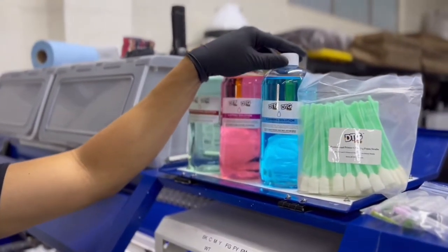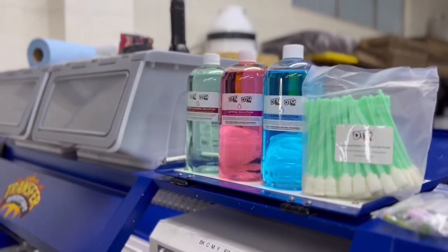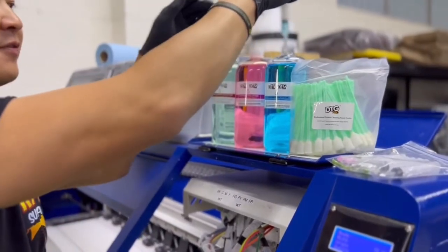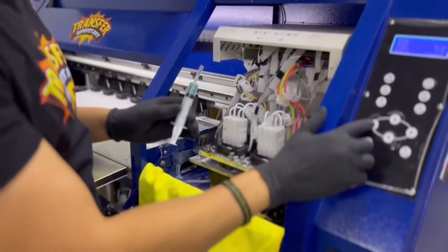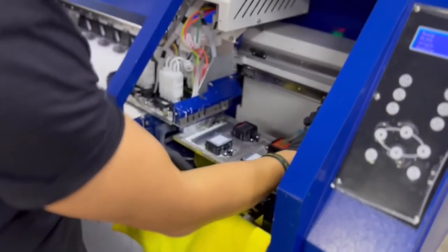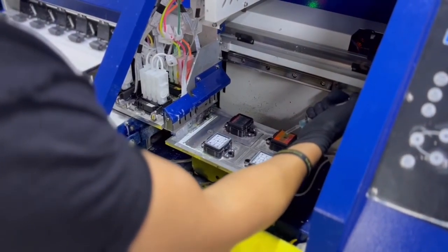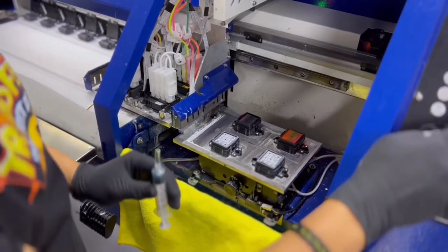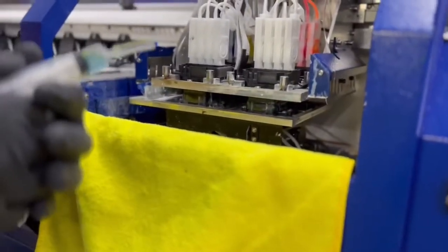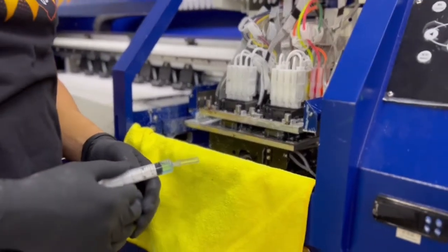There are different ways to use a cleaning solution. The first thing we're gonna be doing is soaking our printhead. This is if you're seeing some banding between your prints — you'll be using one of these syringes with roughly about 5ml of the cleaning solution. I'm gonna jog the printhead over and do something similar to a wet cap, which is to fill it up halfway and return the printhead to its position. Make sure it sits on there and wait roughly about 30 minutes, and hopefully the solution will break up any of the solvents in the ink and clear up the printhead.